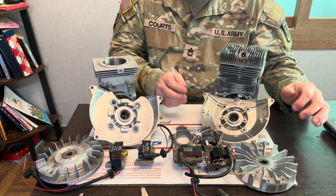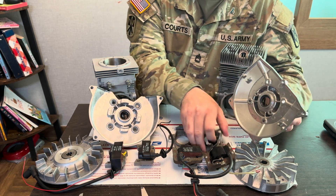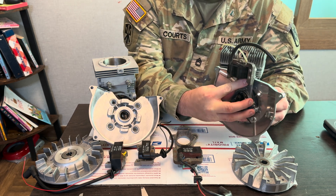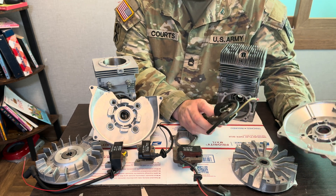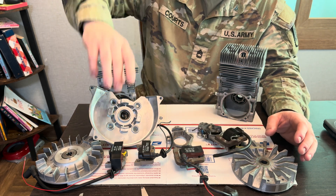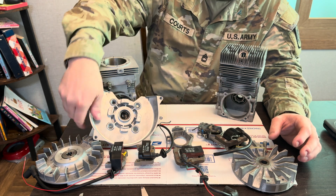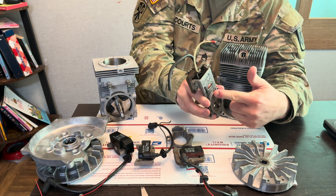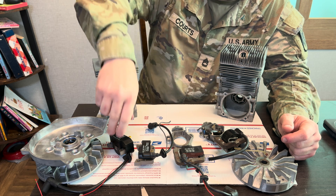Let's look at these items chronologically, right from old to new. This is a support plate — it supports your stator. You've got three mounting points on your stator that align with the three mounting points on your support plate. If you want to upgrade, you can't just put one of the modern coils onto your engine, because the modern coils no longer bolt to a stator plate like this — they bolt directly to the engine cylinder.